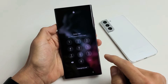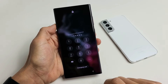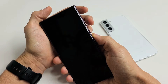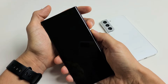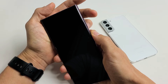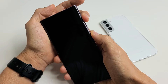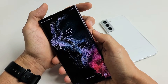So let's go ahead and try this. My password is just not working. Now watch very carefully. What we're going to do is hold down the volume down and the power button. We're going to press and hold both buttons and keep holding for about 15 seconds. After 15 seconds, we're going to let go of only the volume down and then press and hold the volume up. Never take your finger off the power button, and then continue to hold these two buttons until we see the Samsung logo, then let go. So volume down, power.